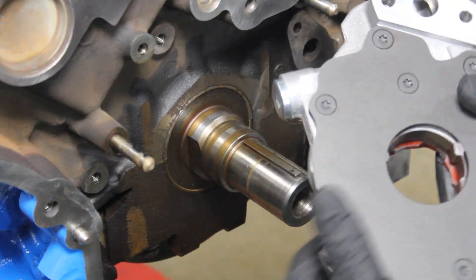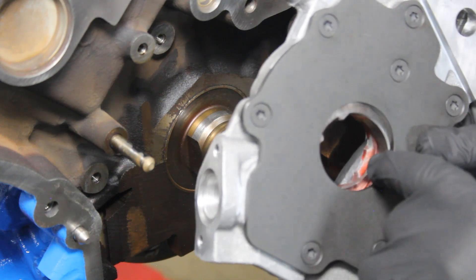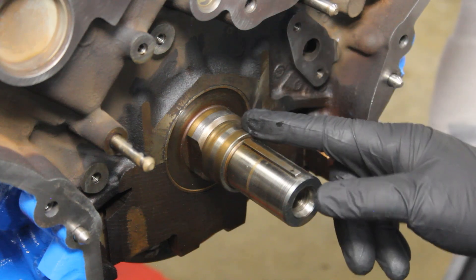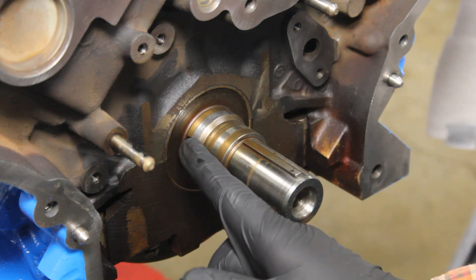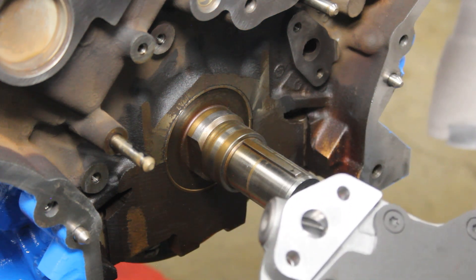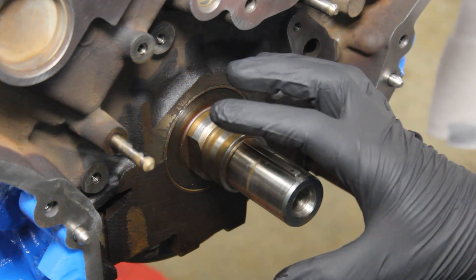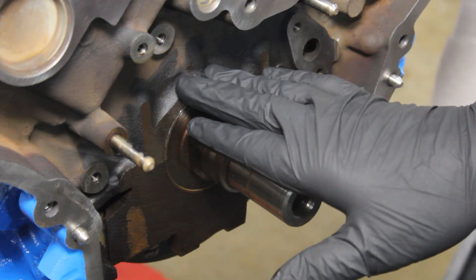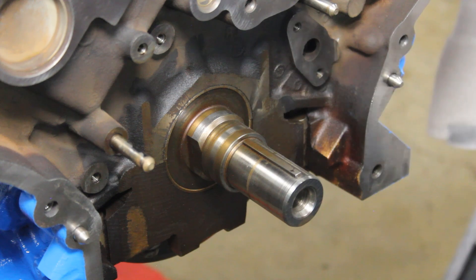When we go to install our pump, if you look real close, you'll see it has a flat side here and a flat side on this side, then it's rounded over here. That lines up with the crank — with the key at 12 o'clock, the crank has a flat side on each side as well. So you line up those flats straight onto there and it should seat right up against the block. The backing plate acts as your seal, so you don't need to worry about any gaskets or seals back here. Go ahead, slide it on, line it up, and then put in our fasteners.